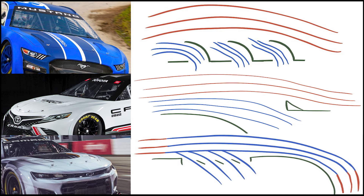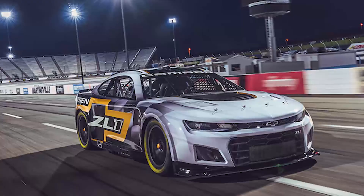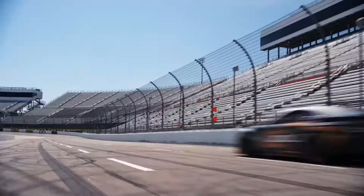The Camaro uses its placement on the bonnet to extract air. This is kind of like how a wing works — as the air flows around the curve from the front bumper onto the bonnet it accelerates and its pressure lowers. So the pressure at the front of the bonnet is going to be a bit lower than the pressure at the base of the windscreen, meaning there is a lower pressure area they can vent into. Now I can't really say if one device has a significant advantage over the others. You would think maybe the Camaro's would be the most aerodynamic since nothing about it is sticking up, but if it's less effective then maybe there is a disadvantage and they need to run more front cooling, for example. It's hard to say really.